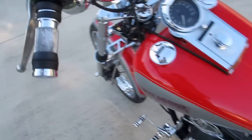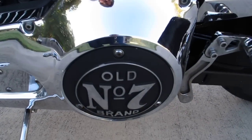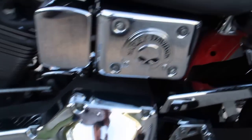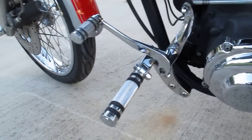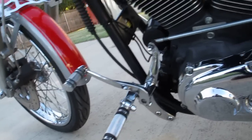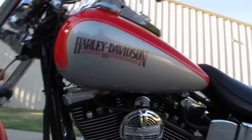It's got a dent right here on the gas cap, and you can see the wear on the buttons, so I'm going to guess it's probably got around 30 or 40,000 miles. The left side of the bike looks good. There are some dents right here on the side. We've got the old number seven right there on the derby cover, and this does have a leak on the derby side. It's also got the dark series cover there by the coil cover. It's got chrome rubber-banded foot pegs — the whole set. You can see some rub marks on the shifter, which further indicates the miles. There's a little leaking going on by the rear base gasket — when it sits overnight it has a leak right here; you can see a little drip.